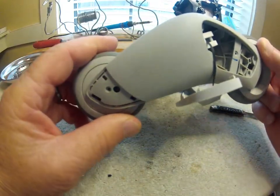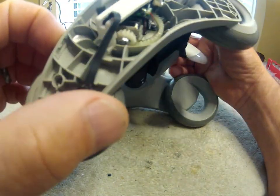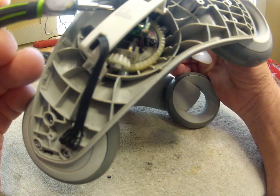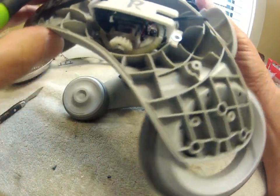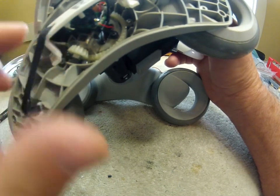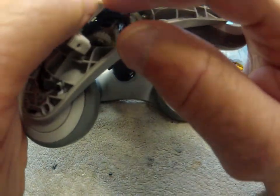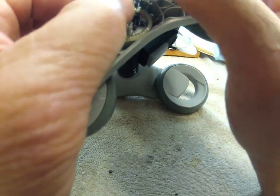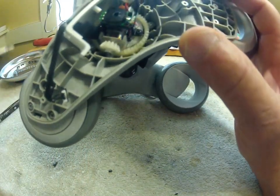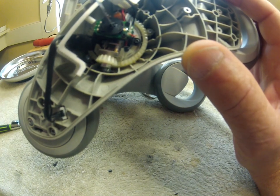Remove four screws, separate the plastic cover, transmission is free turning — broken motor. Let's take the brackets apart. This bracket helps the sensor know the position of the leg. The flat side helps the sensor know the position of the leg. Underneath it's flat on one side. This flat part, when assembled on the right side, faces towards the free-rolling wheel. It aligns with and meshes with the flat part of the rotating sensor resistor.